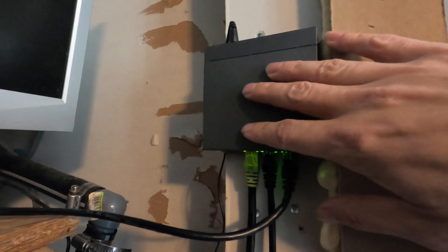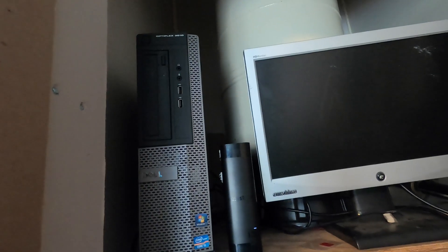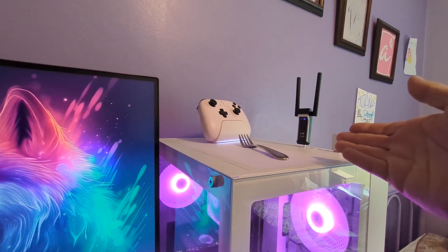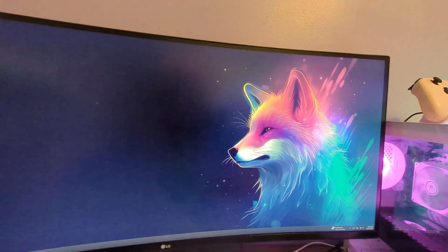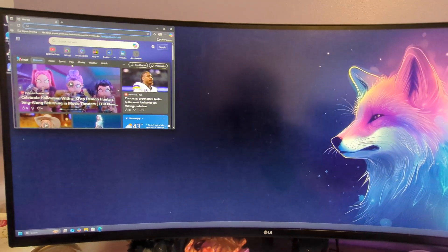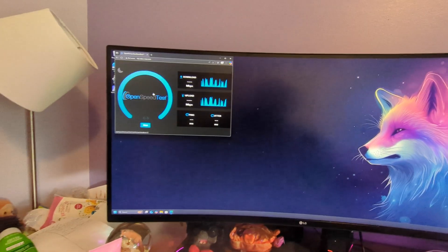On the house side, the cable from the EAP 211 feeds a PoE switch, which provides power for the EAP 211 as well as the outdoor access point mounted on the side of the house. A cable also runs to our Syncthing backup server, which speed tests at a little over 700 megabits — absolutely phenomenal. Meanwhile, in my daughter's room, despite having a Wi-Fi 7 USB card, she was only getting about 100 megabits before because the access point was using most of its 5GHz antennas for CPE backhaul. Now with a dedicated bridge, the Wi-Fi speed is about six times higher.